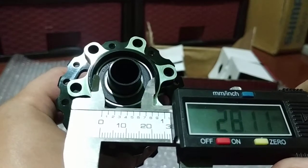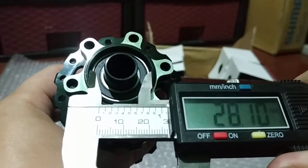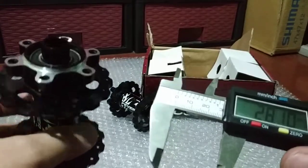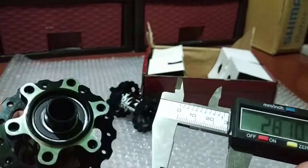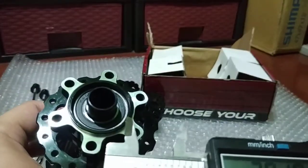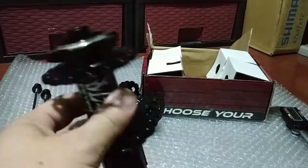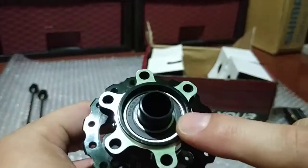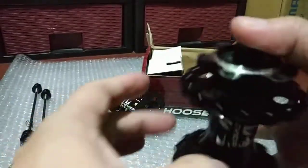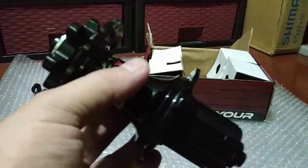Close to 28 — so if you Google 6902 that will give you the specs: 15×28×7. Unfortunately we can't measure the thickness because the bearing is inside the hub. Most likely we have 6902, which is good news because it's really easy to grab them — you can go to a bearing center and buy them, or come to my shop; we do have NBK 6902.